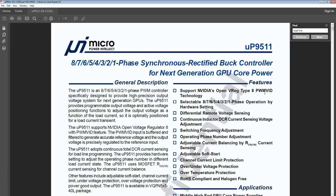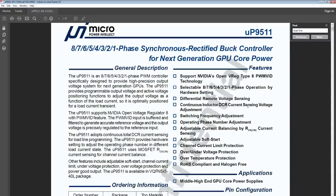What I want to add to the 1080 Ti is: enable/disable loadline, disable overcurrent protection, adjustable loadline so I can tweak it up and down, change the switching frequency, and of course completely manual voltage control. I also want to force the phase count. Those are all the different modifications I want to do to this chip, and we'll start with voltage control because that's the most important one — if you don't have voltage control, you're not going anywhere.